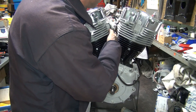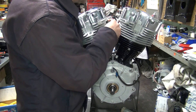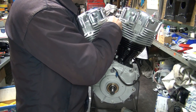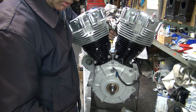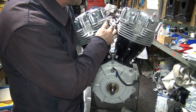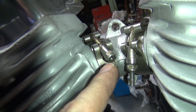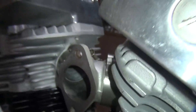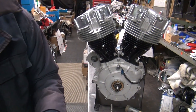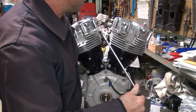Bend this around a little bit, slip it up in here. Wrap yourself around the motor. Try to squeeze the clamp to get all your fingers over there — which is hard to do — and put the nut on it. So right now we have the manifold semi-installed. The nut is just barely on there, this one is loose, the manifold's kind of semi-on. When you start tightening this clamp up here, this one is going to pull it straight. Make sure you're pushing the manifold in as you're doing this.